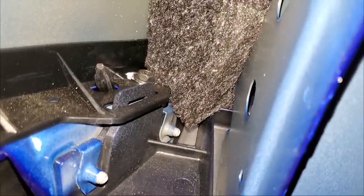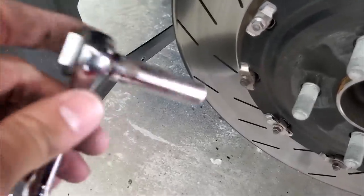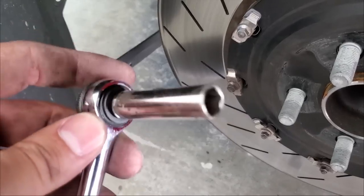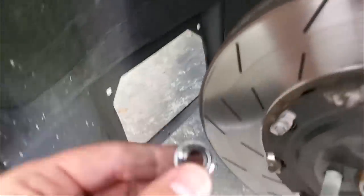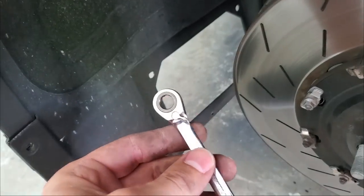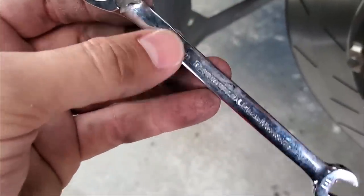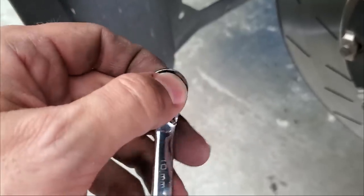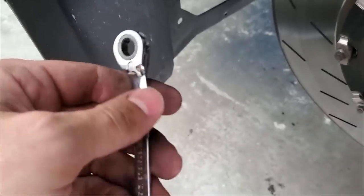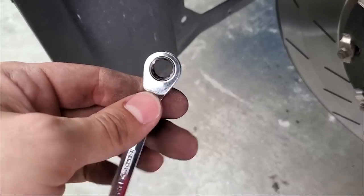Alright, that worked out pretty good — it's right there, and that's a 10 millimeter. The next one is up there — I'll put a little arrow. It's a little tough to get to but you can manage it. For the first one I just used a quarter-inch small socket, 10 millimeter, and it got up there just fine. These gear wrenches are really handy — that went up in there and got that last bolt for me. These bolts are not very tight, so if you feel like you've only made like one turn, it's probably true — the other side was just a notch over hand tight, and somebody else said that in another video as well.